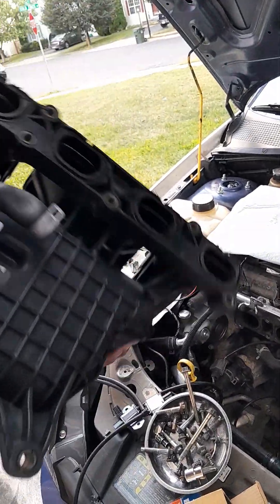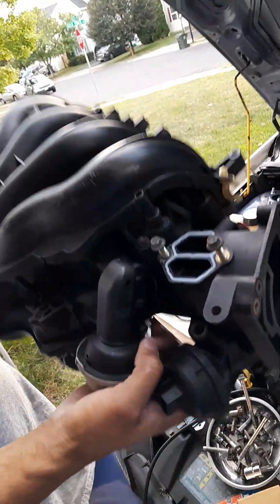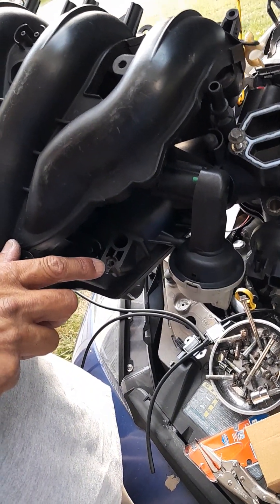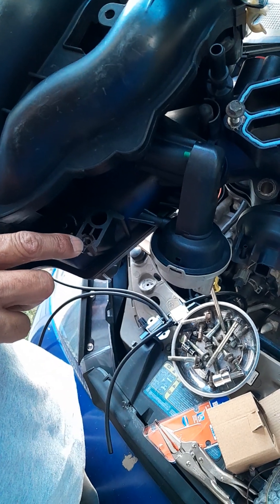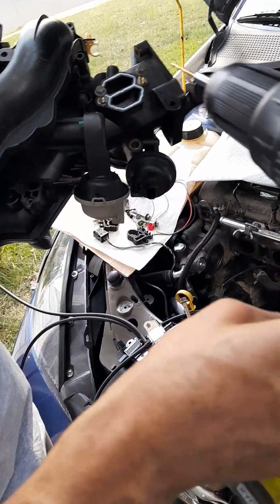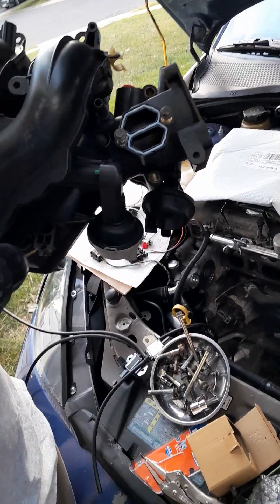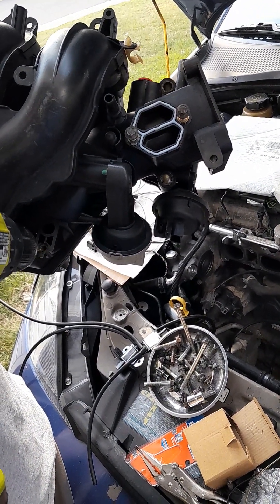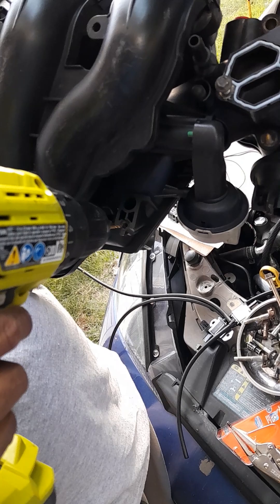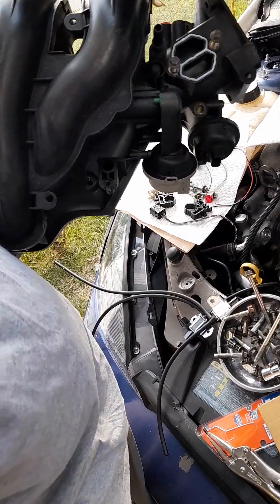For a 2004 Ford Focus, I want to talk about the intake manifold. I'll start with the MAP sensor - the screw head broke off. What I had to do was use a 3/32 bit in the rim around the broken screw on the plastic manifold, drilling around it until I could get a bite on the head so I could use a vice grip and take it out.